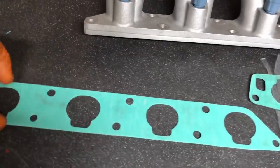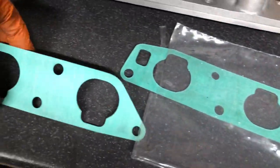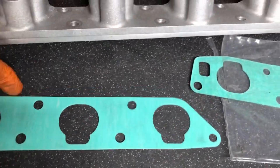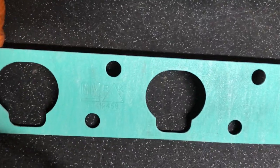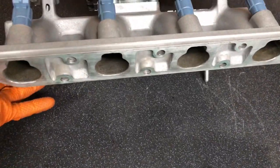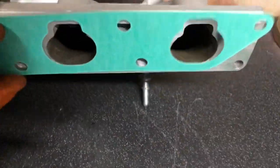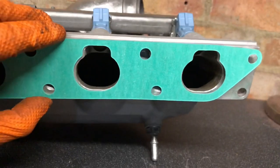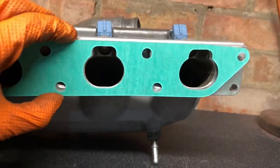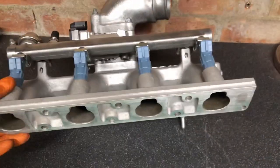We're going to finish it with GM brand new gaskets on there. I've got a few of these in - they're the best fit for these EDS manifolds, absolutely perfect fit for the port. These EDS manifolds are really high quality as opposed to an aftermarket one that is nowhere near the same quality. If you match up the ports you can see they're pretty much identical - almost perfect. The GM gaskets are the ones to be using with the EDS manifolds.